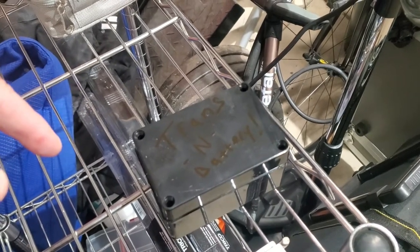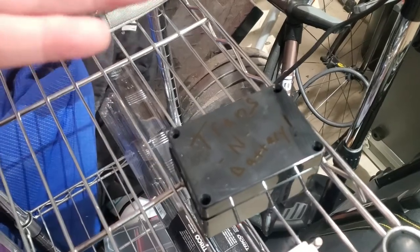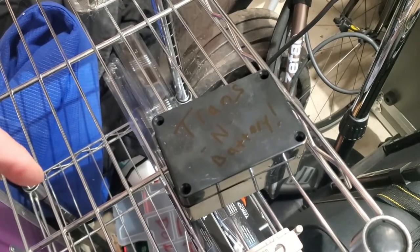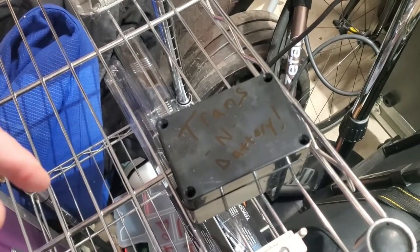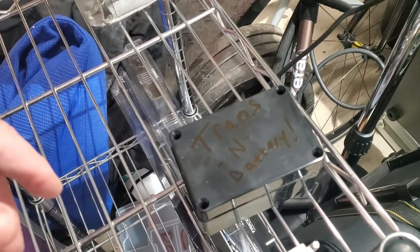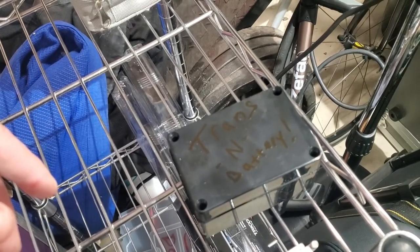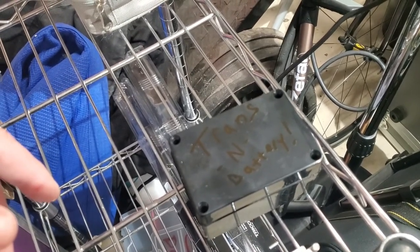Changed the battery and it worked fine, then all of a sudden it stops. When I went there, it was sitting at the bottom of the post instead of on top of the tray. The post is made of metal, so it basically turns it into a Faraday cage and doesn't transmit. He didn't believe me, so I taped it on top of the plastic top, pushed the button about five times and it worked every time. Took the tape off, let it drop to the bottom of the tube - push the button and it doesn't work. It literally just blocks the RF frequency from transmitting.